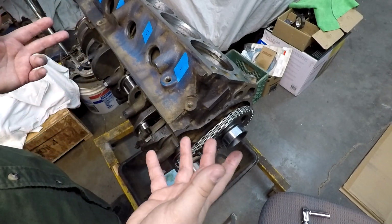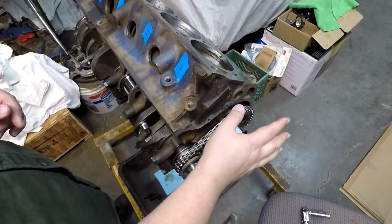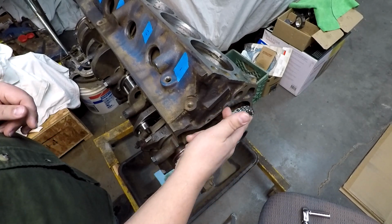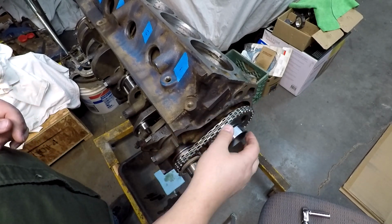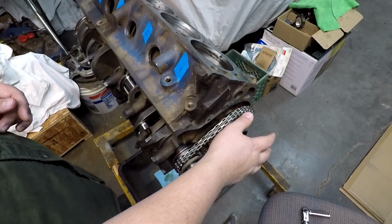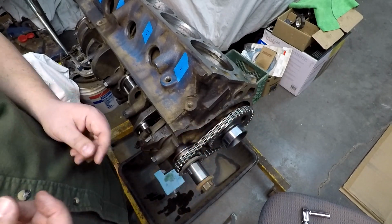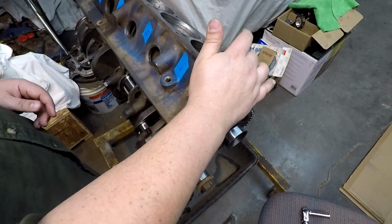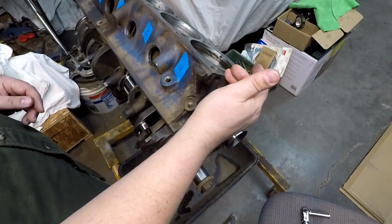One thing I will point out, if you guys probably will notice it at some point in this video, when I put the timing set on the other day, I had totally forgot to clean up this surface ahead of time and make sure that was prepped and ready before I had gotten that far. So I actually had to take this timing set back off so that I could go in here and properly clean this surface and get the rust and the surface crud off the top of it. Actually ended up doing that on one of the cylinder head surfaces too. Totally did the other side, totally forgot the other side.